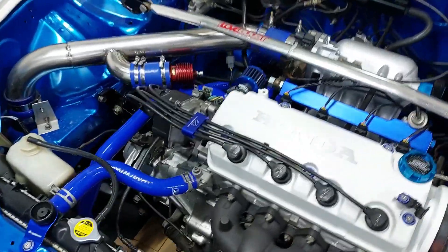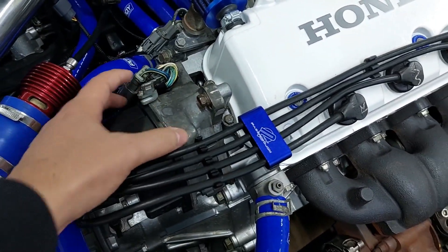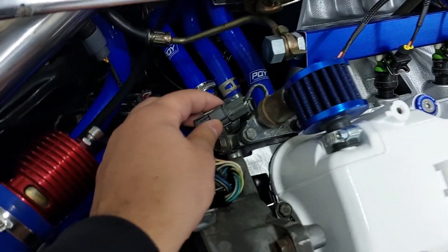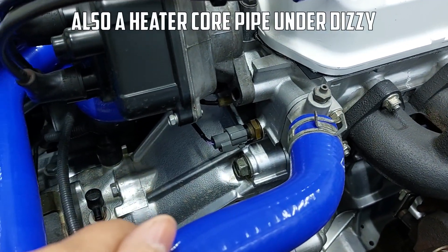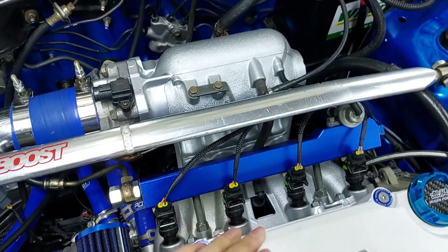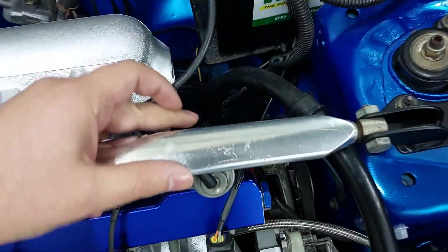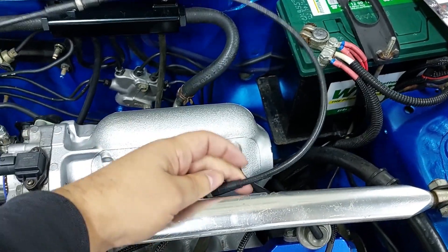It is quite a job but it isn't really that difficult — it sounds way more intimidating than what it really is. Going over to the engine, one thing you have to do is drain the coolant because this pipe is connected to the cylinder head as well as the one back here. Next is quite easy — three bolts on the distributor and that can come off. You can leave it plugged in, leave it in this area. These just pull out really easy, and then you have to consider: if you have VTEC you'll have the VTEC plug back here, you'll have two temperature plugs on the side of the head. You have to take them out — that one there might actually hide from you, and you don't want to just pull on it because you might damage the wire. The other thing is you'll have to take this pipe off, and then you can leave the intake manifold on or take it off.